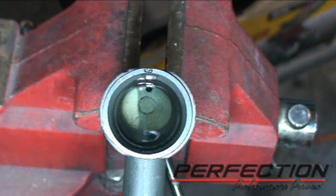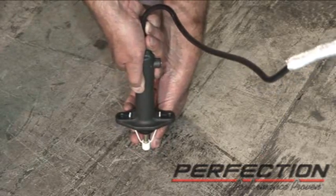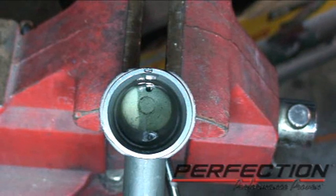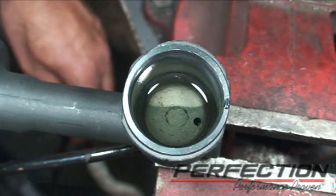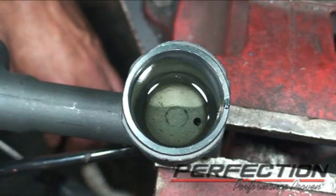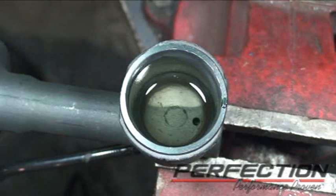Next, we're going to connect the retaining straps again. And now we'll start checking our work. Now we're looking straight down into the reservoir, and another technique that we recommend and use a lot is you just tap on the line. Screwdriver handle, something, an extension, tap on it, and oftentimes that alone can dislodge a bubble and send it up. That's looking good.